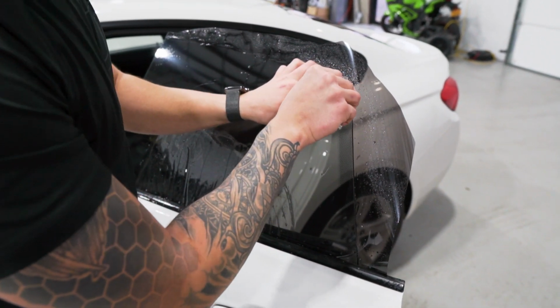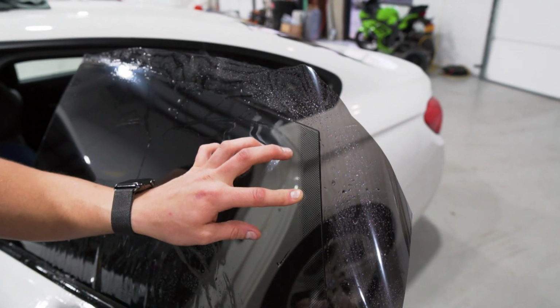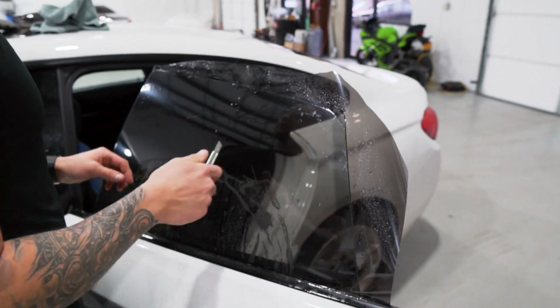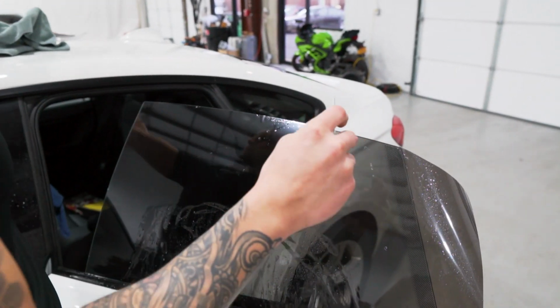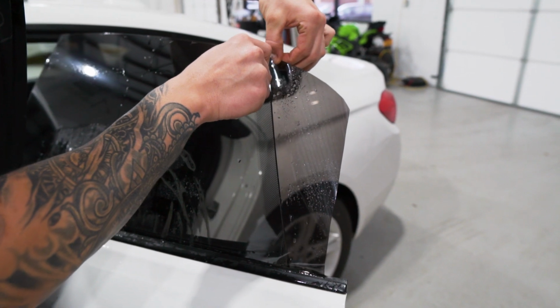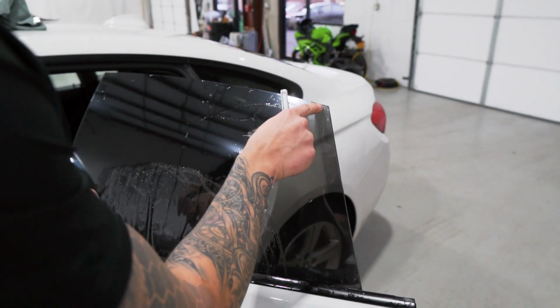Last thing you want to do is try to radius the blade there, end up dulling it out, and then when you do cut that back edge, it'll create a little jitter, causing a shark bite looking tear in the material. So we'll cut the top edge first, and then the back edge. And then we can hand trim that radius.